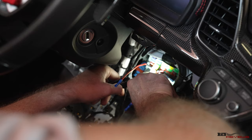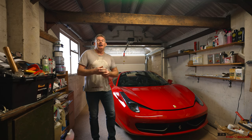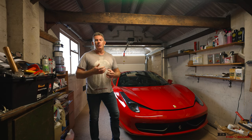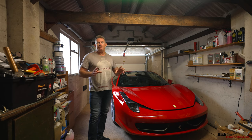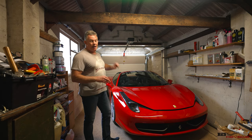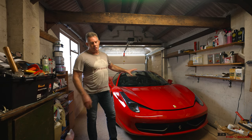There are various ways of connecting the system. You have to connect the dash cam to the fuse box with an ignition-switched power supply so it can detect when the ignition is off and switch into parking mode. You also need a constant battery supply regardless of whether the ignition is on or off. On the Ferrari 458, there's a fuse box behind the passenger console, one under the steering column, one in the rear behind the driver's side, and one near the battery with a dedicated battery ECU.